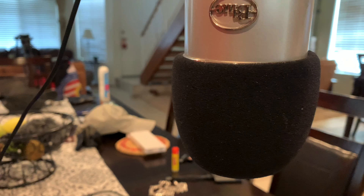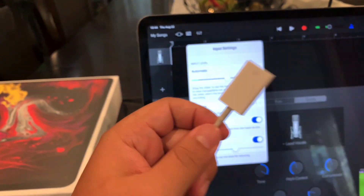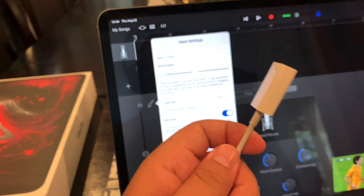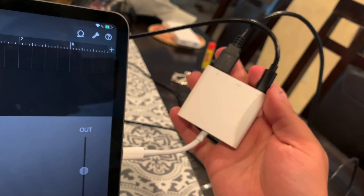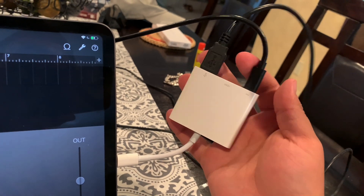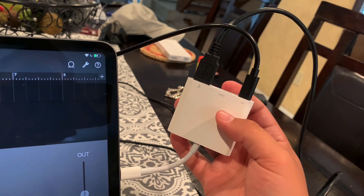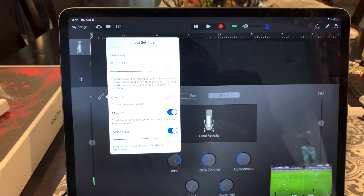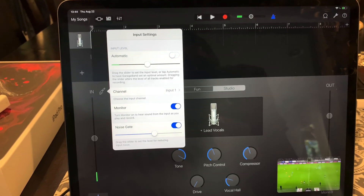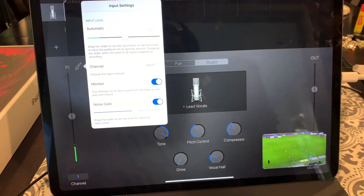For those trying to do a podcast from your iPad, or needing to use a microphone, or using another USB peripheral that isn't responding with the $20 adapter — unfortunately you're going to have to buy this more expensive adapter that requires power pass-through. Then you can plug in whatever USB peripheral you own. You do get the benefit of HDMI out, but with the HDMI out you're basically just screen mirroring to a TV or monitor — you're not actually able to use it as a second monitor, at least not right now with iPadOS.